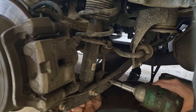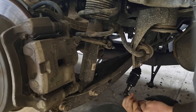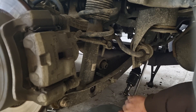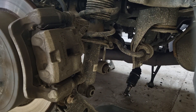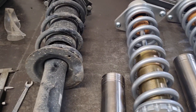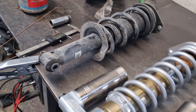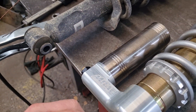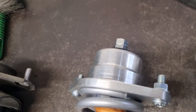Now that the front coilovers are all done, it's time to turn our attention to the rear. These are the MCAs that I bought and they should just bolt in, almost. Now that I've ripped out the factory coilover, we can compare them with the brand new MCAs. To start off with, they are slightly longer, which is to be expected — more droop travel. And we can see these funny looking top hats that they've got, which effectively give more bump travel upwards, so there's more bump and rebound travel as you'd expect.